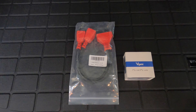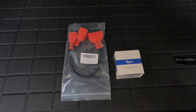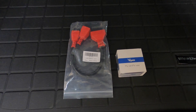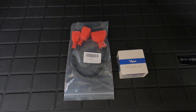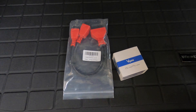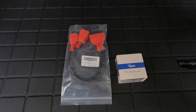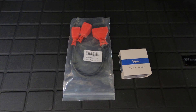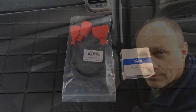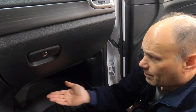We're not going to do any of that because we really want to be able to utilize the dust covers. What we're going to do is use the J-scan software to change some of the vehicle settings to instruct the car to accept the voltages required by LED lights. This is going to involve a few steps which we'll show you. We purchased a Chrysler security bypass cable, a Wi-Fi OBD2 adapter - we got the Wi-Fi version - and we need to download the J-scan app. There are some other apps that may be capable, such as Alpha OBD, but this video is only related to Jeep Grand Cherokee using J-scan.